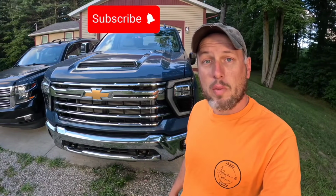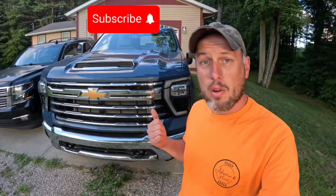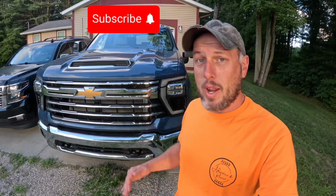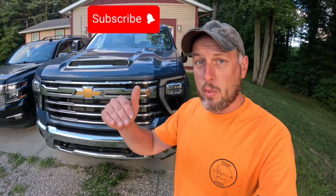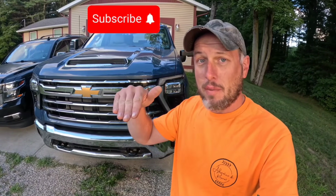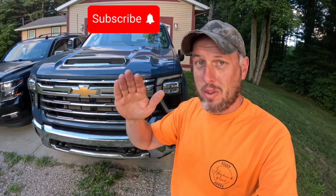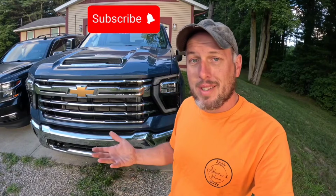So hopefully this quick video was helpful for you in leveling out your 2024 Chevrolet 2500 HD. Now, in the end, we did not get perfectly level between front and rear dimensions. I actually still kept a 1/2 inch forward rake on this truck. So if you put anything in the bed of the truck, it doesn't sit there and look like it's squatted on the back end. So it's not a big deal.